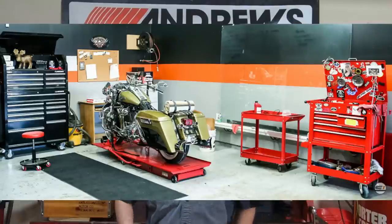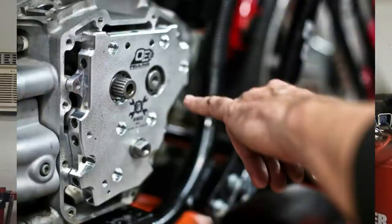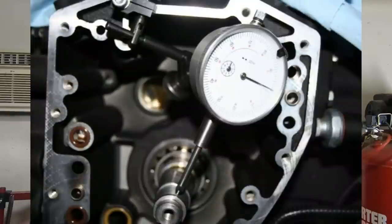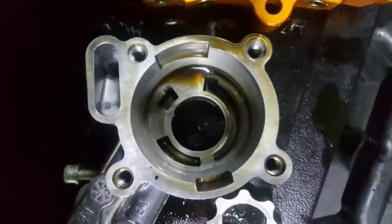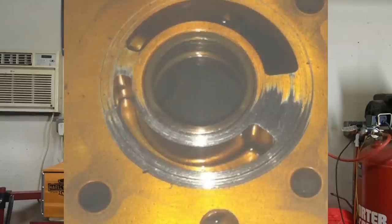When it comes to doing it right, we all know the price keeps going up. Can you go back in with the original cam plate and original oil pump? Absolutely. But you're already down there. I really stump for the Fueling OE cam plate because it allows you to use a factory oil pump, or you can buy Fueling's aftermarket OE pump — a good high-flow oil pump that also works with their OE cam plate. What I like about the OE cam plate is that it's designed to deal with the run-out that press cranks tend to have, so it's a lot less risk than going with the race plate. Also do your run-out check — the worst thing is ordering all those parts, getting it torn down, and finding out you've got well over five thousandths of run-out. You can get away with a race plate at five thousandths, but it's a big risk — you really risk tearing up those parts and that new oil pump. That's not something you want after investing about eight hundred dollars in a new cam plate and oil pump.